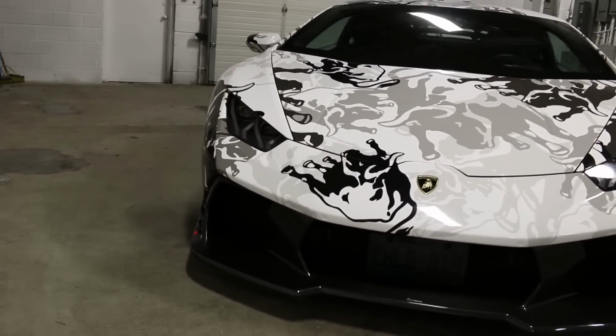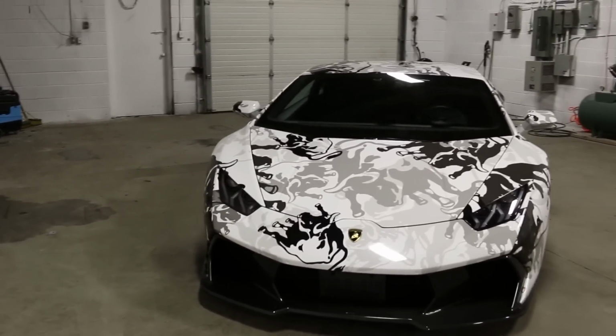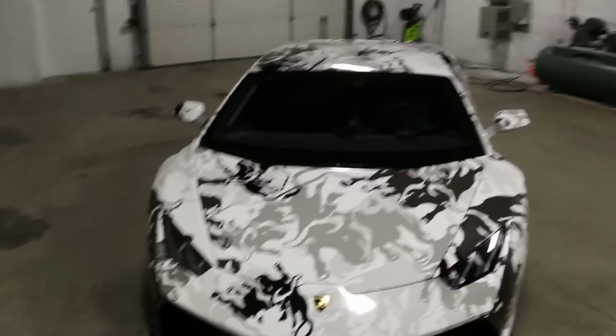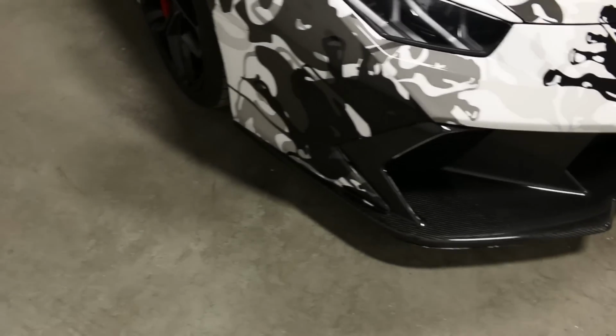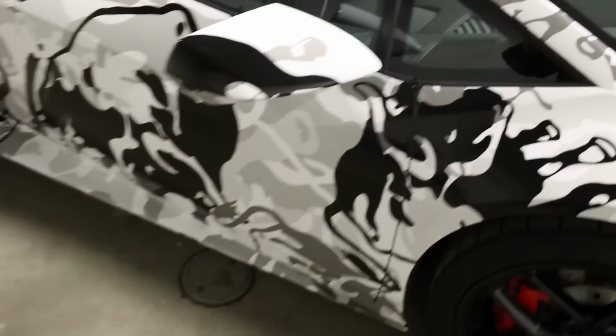And what we also got to do is check out some corners. There's a corner right there. And this isn't thin film, okay? This is thick. I think we're a little around 5 mil, so it's not too thin. I could be wrong, it could be like 4.7. For the pillar, I had to custom stretch it down to get it into the lower fender area. So it requires a bit of manipulation in that way.